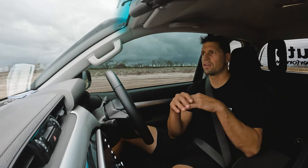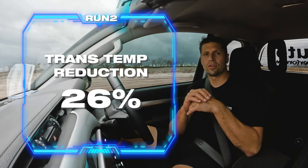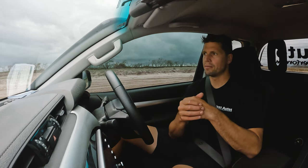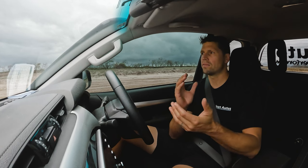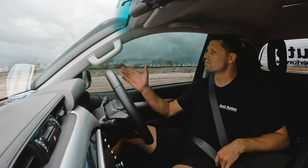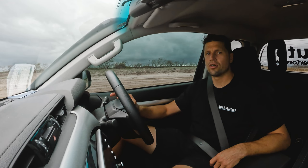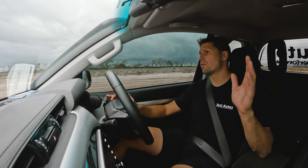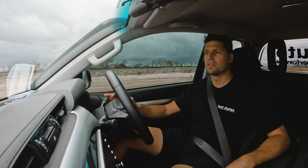That's all from using the low-speed lock-up. When the converter is open, you've got around a 22% slip ratio, and that slip ratio just adds heat. By locking it in, we're now driving like a manual car and not generating all that heat through the converter. So we can pull through this sand, especially at high tide. If you're towing a caravan up the beach and don't know what the tides are doing, or towing up a range for a long period of time, this is definitely the way to go with the Easy Lock kit.